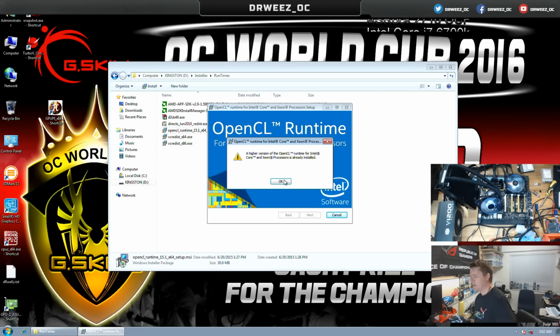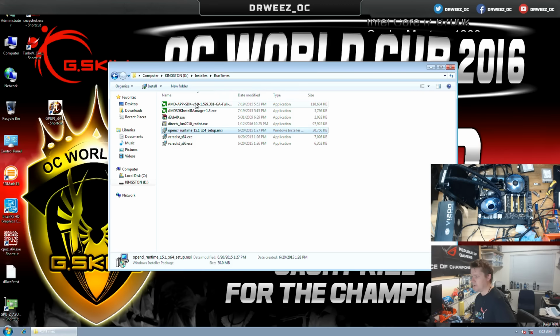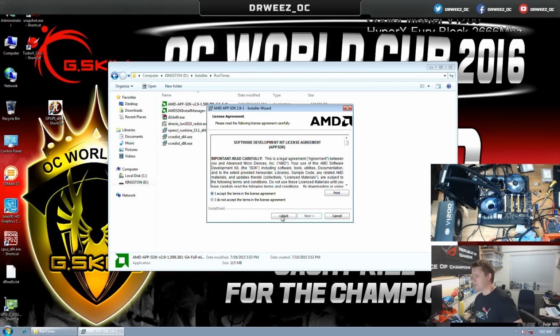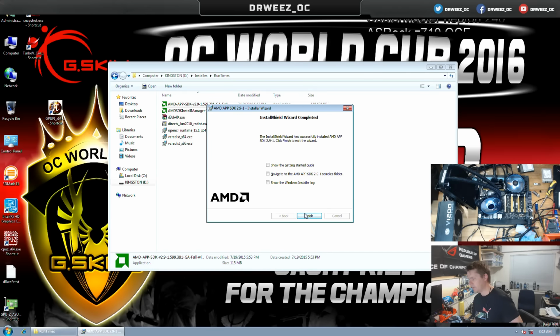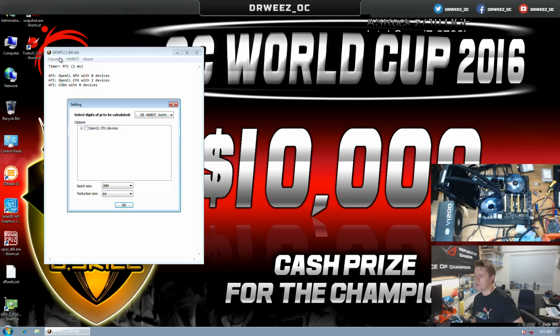The first one is your OpenCL, which I already have installed. And then here is the real pro tip: you actually need to have the AMD one installed, even if you're not running the AMD processor, install it. And then what you need to do is test to see what is the best SDK or runtime to use. Also, once we have a look at GPUPi, you'll see that there are some configuration options, selection options, some batch sizes. So the next thing you need to work out, and actually test, is what is the best batch size to use?